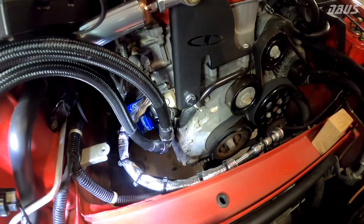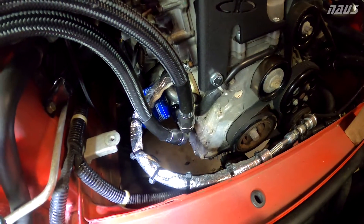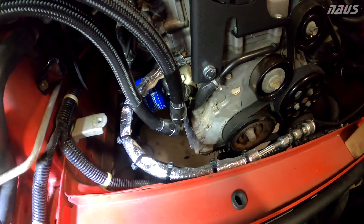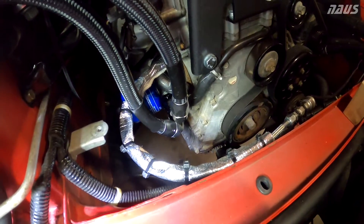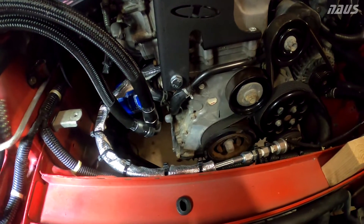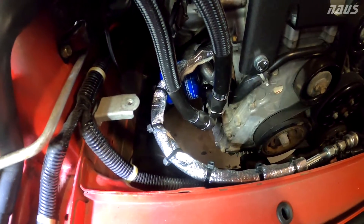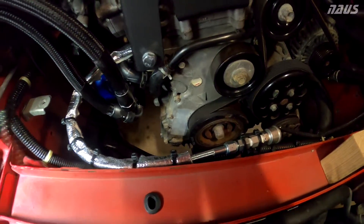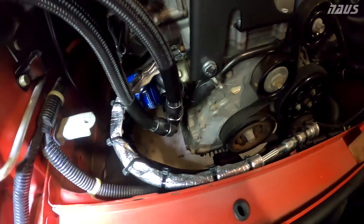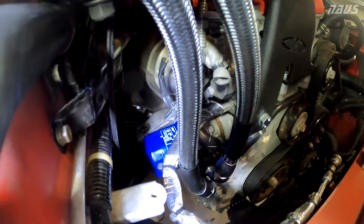Here's the final product. I wrapped it with a heat insulating tube sleeve from Advanced Auto Parts, made by Design Engineering. They make it in silver and gold — the gold can withstand a little more contact heat, but the silver will do just fine for this application. I put zip ties around it to keep it together since the ID of the sleeve is about three quarters of an inch and the OD of the clutch line is less than a quarter inch. I kept zip ties away from the header so they don't melt, and made sure the sleeve goes all the way to the threads into the block.